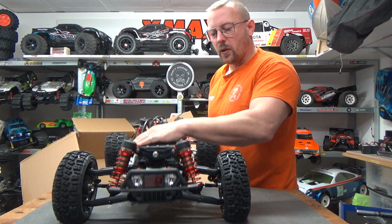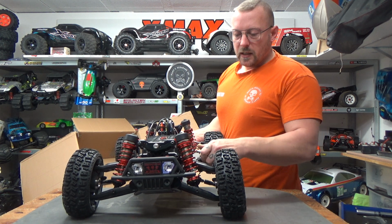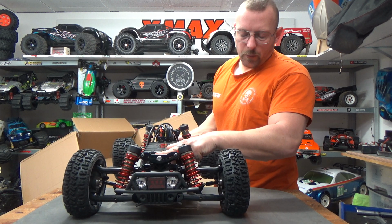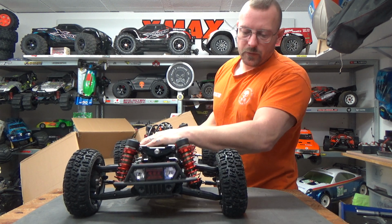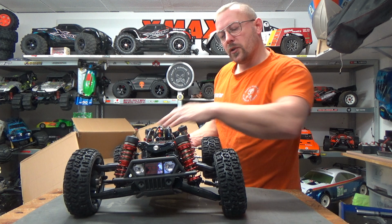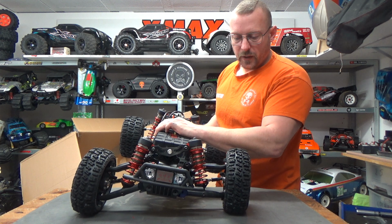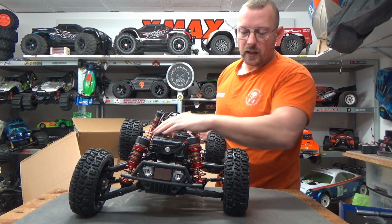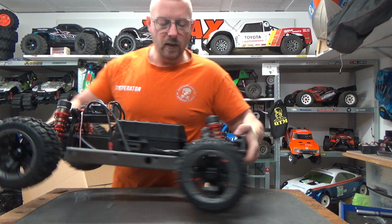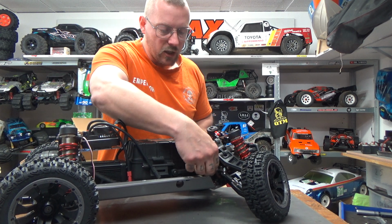I really want to see what happens in the field, if this works as well as they say. And the only thing I don't like is that, look, when I go down, the suspension stops. You still have 2 cm of suspension travel, but you cannot use it. So you're going to think, stop, it's not an issue because you can use it when you go sideways. And nope, look, you are stopped, it's blocked. You cannot use that one, and if you push it down, you will squeeze something at the steering. That's, for me, I'm a car mechanic, and for me this is strange.